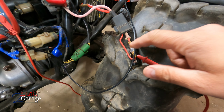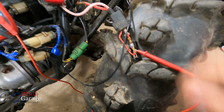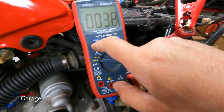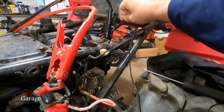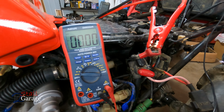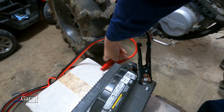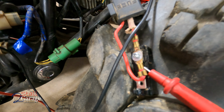stand by. Here we go. It's a little all over the board. I've got it hooked into this fuse that I've got solidly screwed together. Again, that's a 20 amp. It's on auto right now, but we'll just set our range right there. And we've got the ground going into the ground that's connected to the battery on this side. Here is your positive side that runs into your starter solenoid. We're showing 000 across the board. This battery is also pretty new, 7 of 23 if you caught that Omni video. That's what we want, and we're getting that reading from right here in this 20 amp.